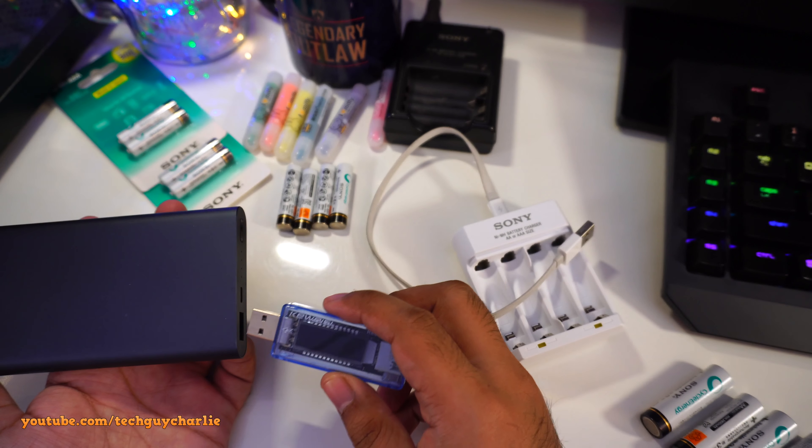Fortunately I have the old charger, so I can put that single battery there. Just to be sure there's no overcharge protection: I've plugged fully charged batteries back in and let them charge for around an hour and 30 minutes — the charger is not cutting power to these batteries. So fully charged batteries are just overcharging in the new unit.